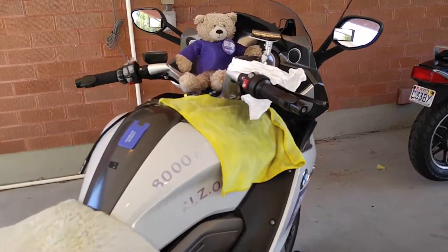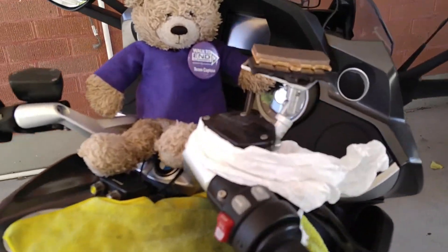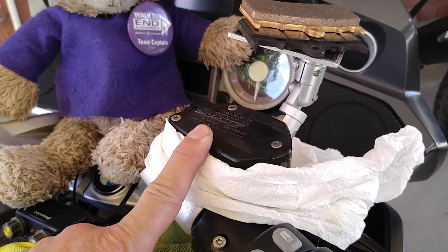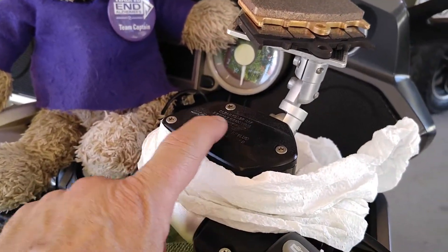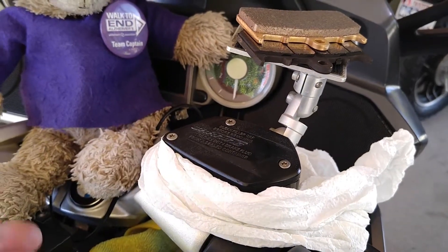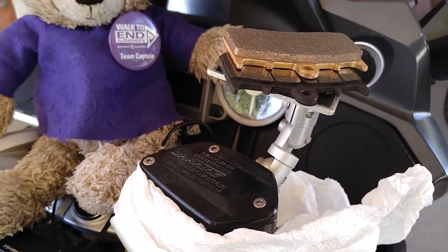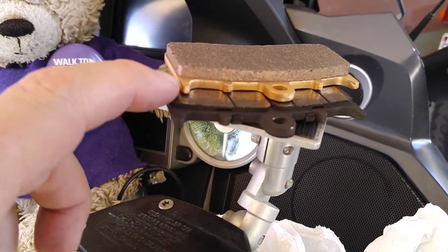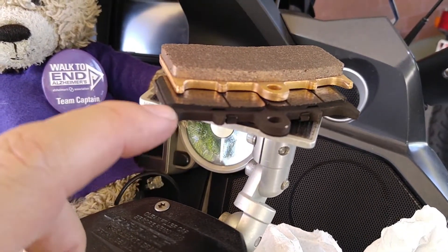To do that we're going to have to remove some of the brake fluid from the reservoir here, and I'm going to remove these three T15 Torx head bolts and suck some fluid out so that we can make some room. Here is the old pad and here is the new pad, so you can see I've pretty much gotten my wear out of that one.